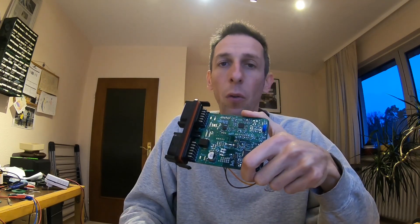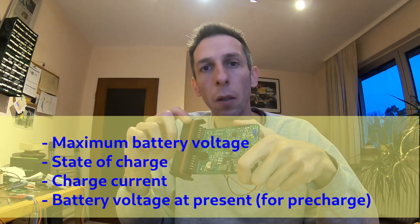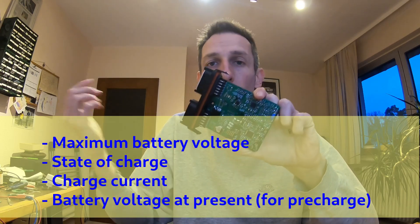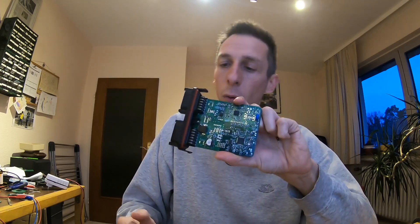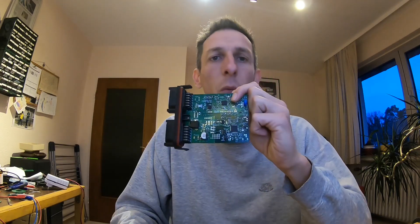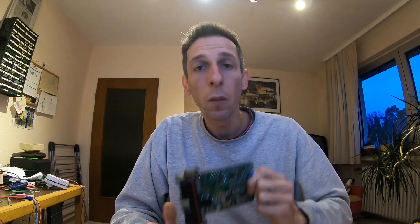The CCS charger needs to know certain values, and those values need to be sent in via CAN and then transmitted via CCS to the charger to enable you to charge. It can also do a little more. It can control the charge port relays with MOSFETs, control some LEDs, and it also has some sense inputs for the temperature of the power pins so they don't overheat and melt down. It is quite a capable product.